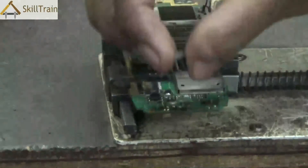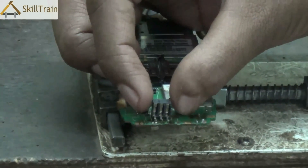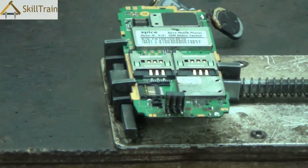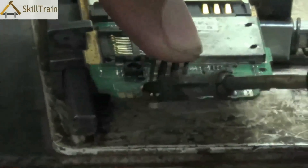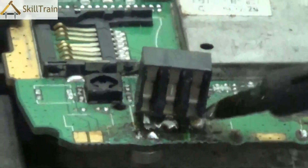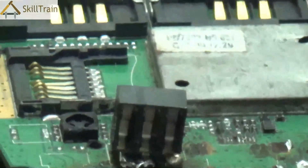Let's hold the PCB on the stand and re-solder it again in its original position. If there is a problem in the battery connector, you take this component off, replace it with a new battery connector, align it with the three tips on the mobile PCB, and re-solder it using the hot soldering iron. Melt a little bit of soldering wire, hold the battery connector from the top, align the tips, and solder these three tips. Be very careful because your fingers might get hurt from the soldering iron. Also ensure there is no short circuit or overlap of the soldering points.